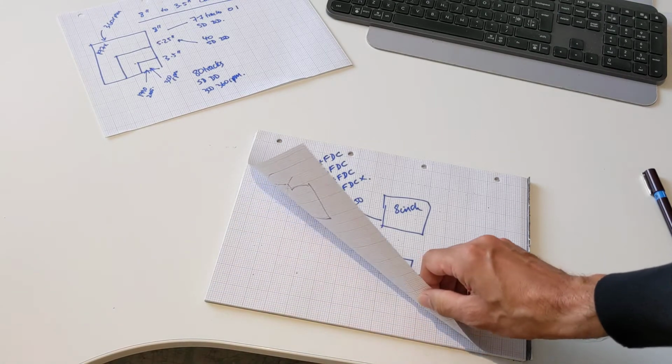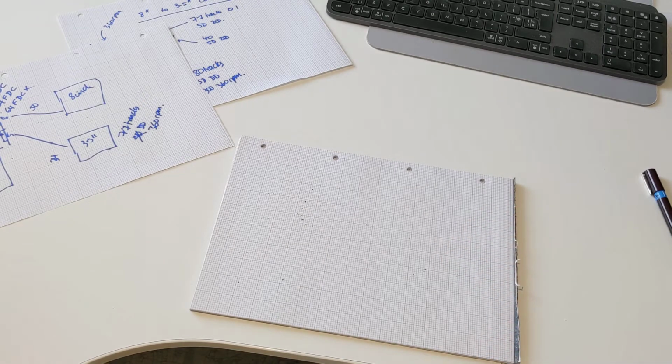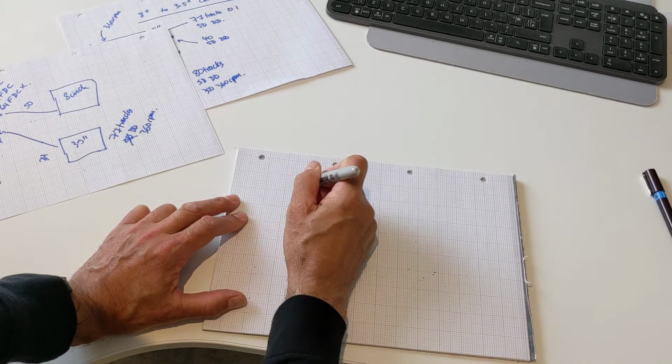There's another quirk, something that Cromemco started off with, which they thought would be very clever, but ended up being a terrible headache. And that's their diskette format. Now, in the old days, there was single density and double density. And when double density came around, everyone just switched to double density. But Cromemco decided, well, what happens if you've got a user who's not supercomputer literate, and they put the diskette into the drive? There needs to be some way that the actual computer can tell what the diskette is. And how could they do that? So what Cromemco did is something that they thought was very clever, but ended up, like I say, causing huge headaches for me and everyone in the vintage computer world working with Cromemco systems.